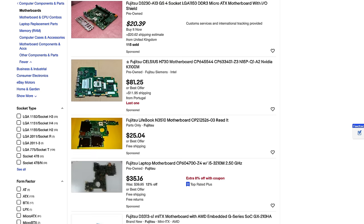The SSD array you use for caching can be as small or as big as you can afford, but in this situation bigger is better. If you attempt to write a file that is bigger than the whole SSD in one go, you'll probably encounter an input-output error. Apart from that, the bigger your array is, the less you'll have to spin up your hard drives, which means more power savings and longer drive lifespan. For my NAS, I currently use a RAID 0 array of two 1TB consumer-grade NVMe SSDs, and it has been plenty for my use case. I'm planning to upgrade it to an array of four 2TB WD Red SSDs soon, so make sure to subscribe if you don't want to miss that video.